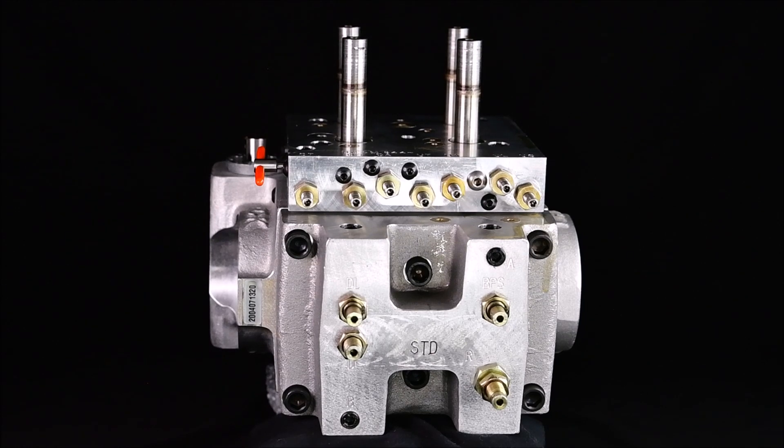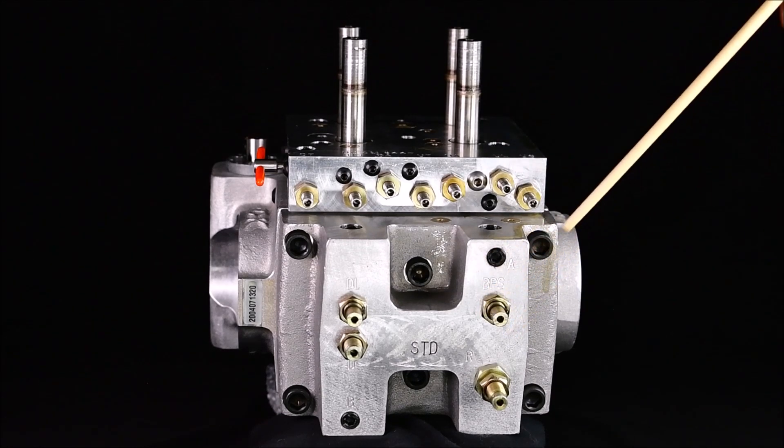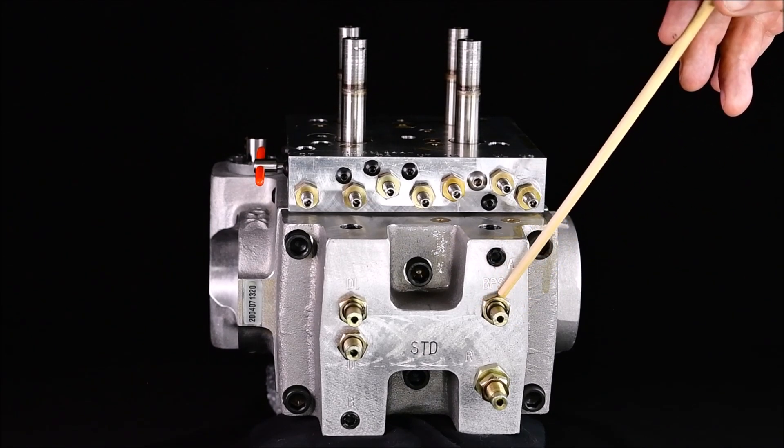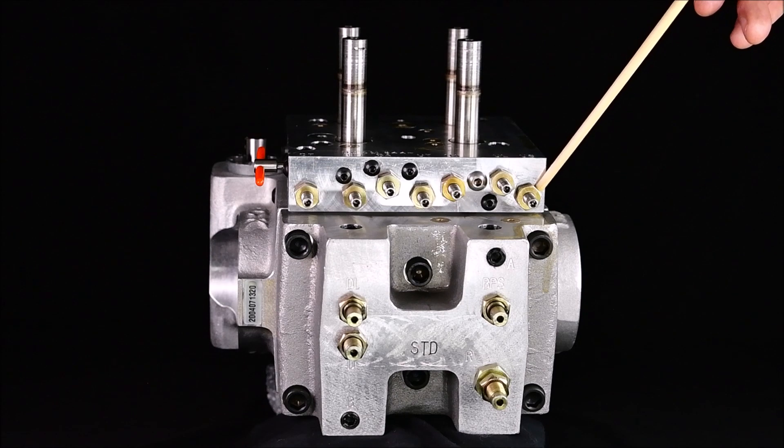When you take the valve out of the box, get it installed and set your bypass without your coil on the slow speed solenoid — just remove that either from the controller or from the valve. If you take it off the valve, be sure to put a big T-handle or screwdriver through it so it doesn't burn up. For bypass: turn in until the car moves, out until it stalls, then take another half turn. If your car is already moving, there's a good chance the bypass might be too far in — remember, it's a hollow tube so we turn it in fairly far. If you turn your bypass out and the car still insists on moving, the up stop adjuster may be too far in. So if your car still wants to move with the solenoid removed and the bypass out, turn out on the up stop adjuster.